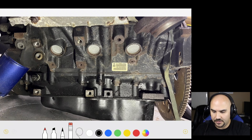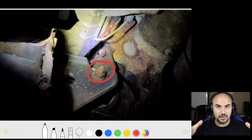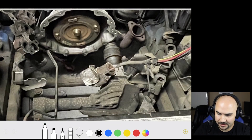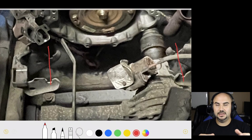If this side looks weird, it's because it's actually missing the motor mount. Here's your motor mount bolt — that's all you're doing, just loosening it; you're not removing anything. That's going to allow the bolt to remain supporting the weight of the engine. The actual motor mount bolts sit right about there, and you don't actually have to remove them — you just want to loosen them up so that the engine will move freely out of the mounts, because the bolts are actually supporting the weight of it.